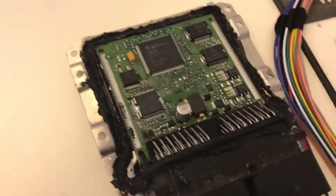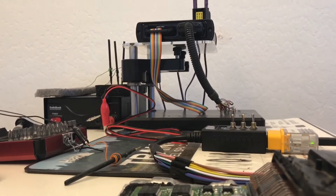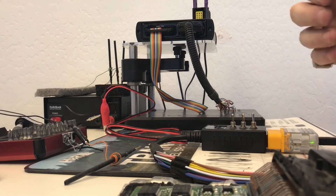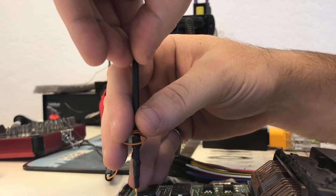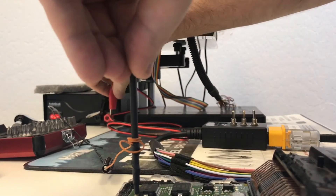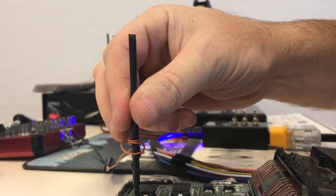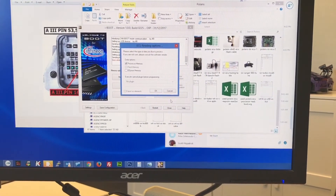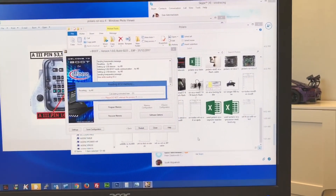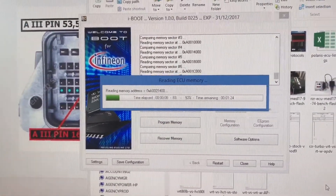We're checking the wires and we had one of our CAN wires on incorrectly. So we want to go back to putting this in boot mode. We'll turn the power supply on, put the boot pin back, connect our power, and then remove the boot pin. Now let's go back to our screen — read memory, processor, OK, save. And now we can see that it's reading out the data from the ECU.